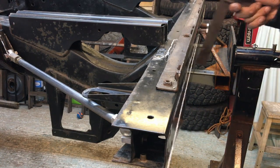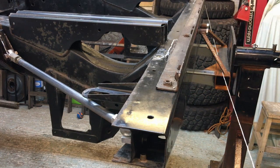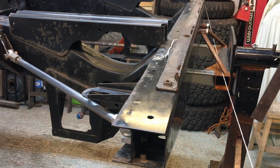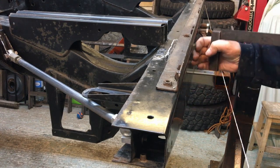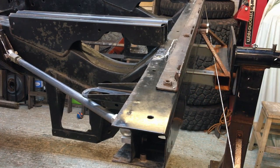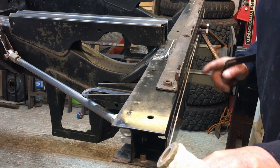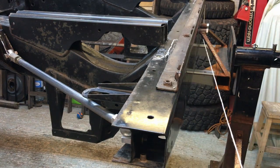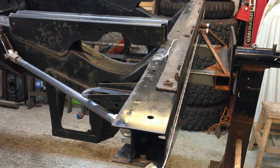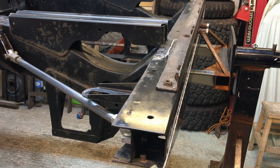There is a slight depression here — there are two vertical welds inside this box section area which I can't get to now. I could slice down through here to get to them, but that would mean a really professional beautiful grinding and sanding finish to get a lovely finish on there, possibly using some filler. I don't want to do that. I think I'll probably leave it because the depression is like maybe a millimetre. The thing is it's the ends that matter — you're not going to see a lot of this anyway because the spare wheel is hanging over everything. It's these ends that matter. We'll see the other side — if that looks worse then I will cut down there and do the dressing and give it a very light skim.